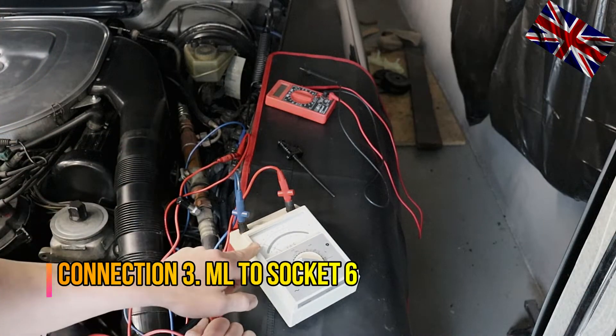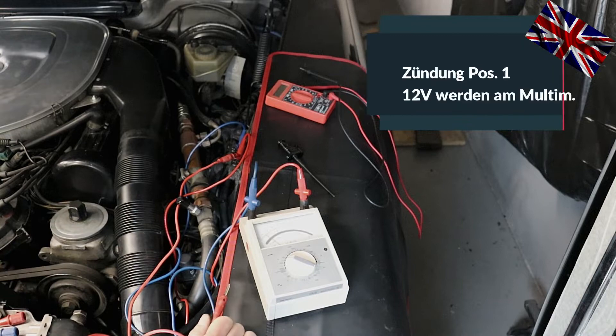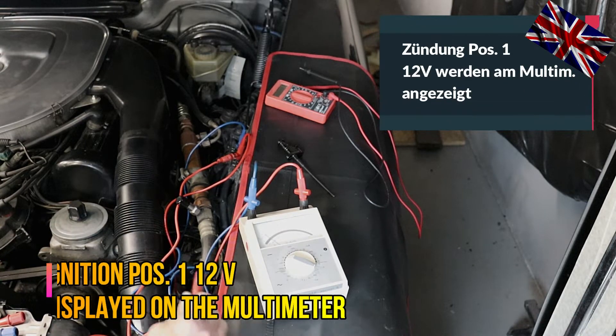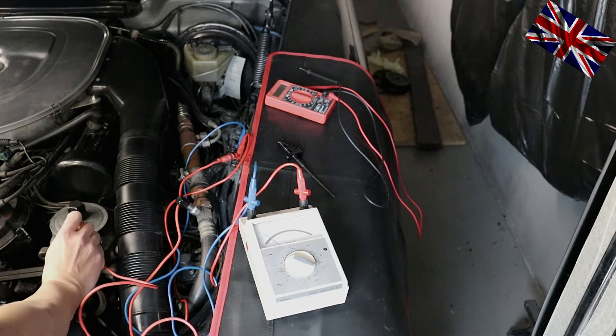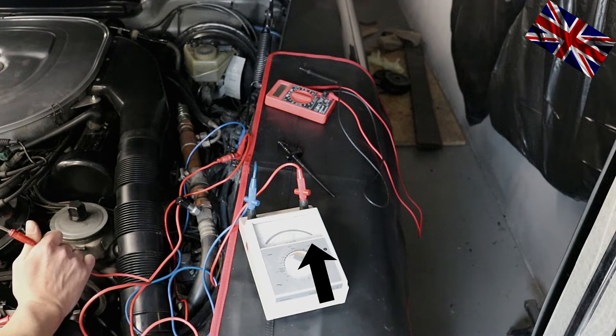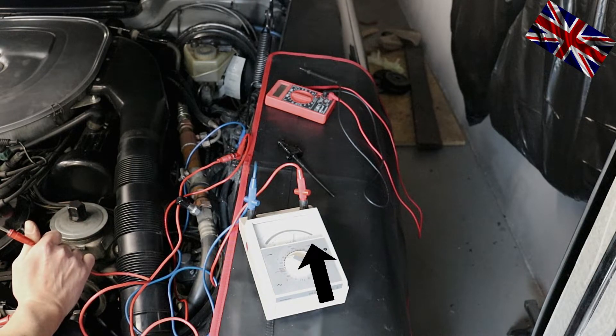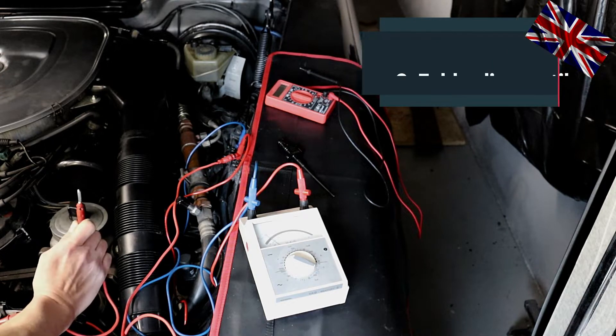I now place the leftover end of the cables to ground, just anywhere on bare metal, for at least 3 seconds. The needle strikes one time fully to the right. I lift the tip of the ground. A couple of seconds later, I hold the tip of the plug to ground again for at least 3 seconds. It strikes fully to the right one time, which you do not include into counting. The following 5 strikes do count.